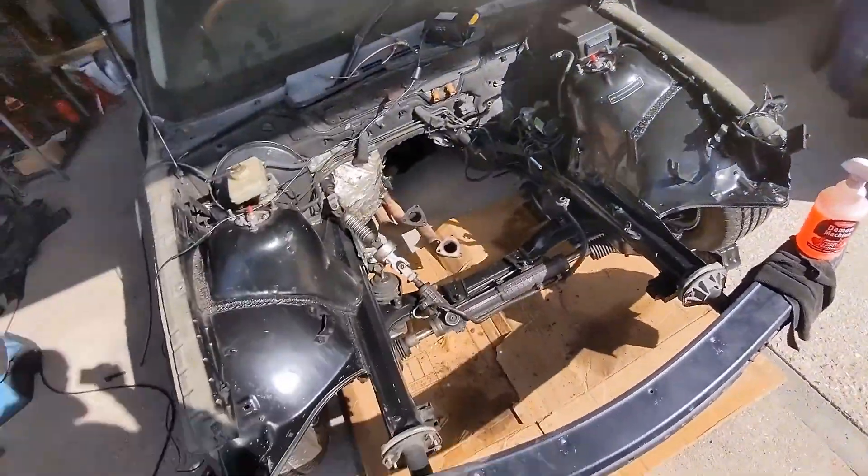Off camera, Harry was telling me that apparently his car has a 325i rear end from factory, because there's literally a tab on his diff saying 3.15 — which is literally insane. I didn't even know that was possible. I thought all 323i autos came with a 3.07. Apparently because his is an August '95 build, it was on the cusp of the facelift and they hadn't put the new diffs in yet. So he has one of the rarest items in the UK E36 world — an open 3.15 diff from factory. He wants to make it into a sexy street car, go low, add some aero. It'll be sick to see, and you'll probably see it on the channel.